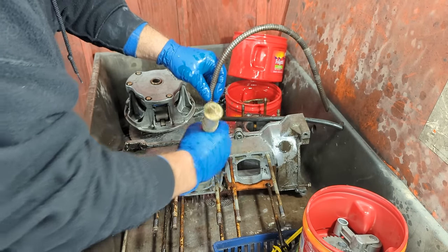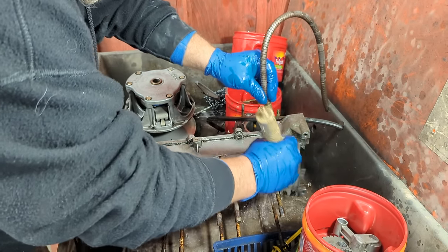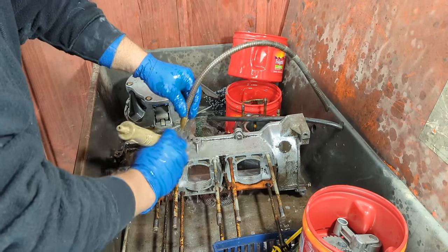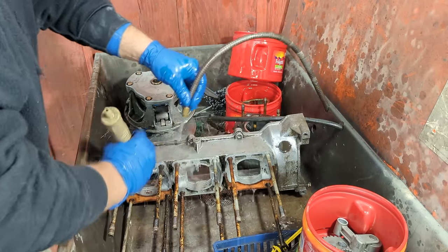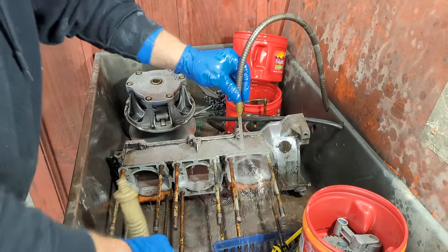This hardware is out of my engine — my engine was a very clean engine. It had never seen salt, never was trailered down the road. Every bolt and nut out of this engine looked brand new. I'm doing a cylinder and the top case half for demonstration purposes here. Parts for my engine are already clean and ready to go, but I'm going to go through the process of cleaning a cylinder, blasting it, honing it, checking it, and then cleaning up the case half to show you the oil mod.